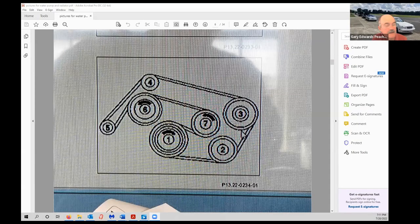The next day I removed the serpentine belt and checked all the components by spinning them to see which one made noise. Anytime you take one of these serpentine belts off, always have a belt diagram with you — this one is from the workshop manual, but a pen sketch works fine. It's fairly easy to put them on wrong and sometimes they'll actually go on wrong. I did it once — it lasted about three miles.